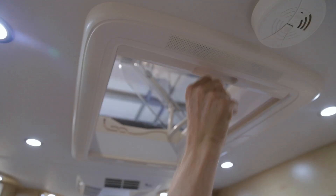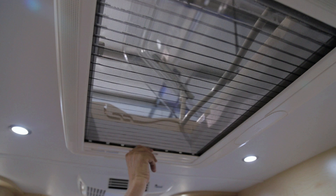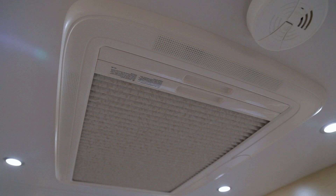To close your skylight, unlock and release from the open positions, allow it to slide shut, lift the handle, and lock it over the center locking mechanism. Additional features include a screen that can be slid across to protect against bugs when the skylight is open. For hot and sunny days or at night, you can slide the nightshade closed. It is recommended to keep the nightshade closed when the vehicle is in storage to prevent sun damage.